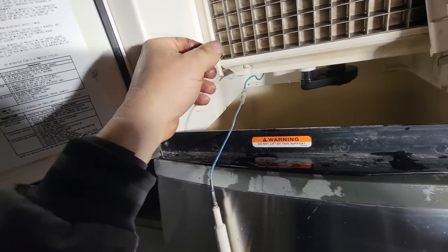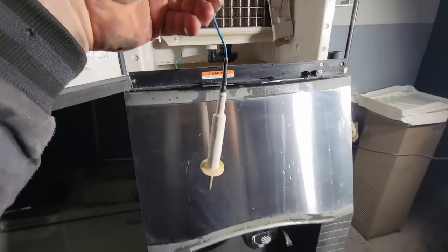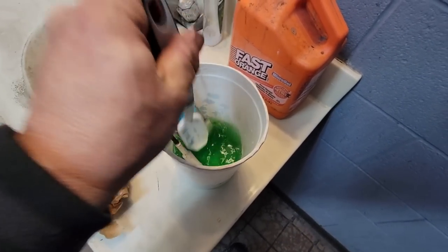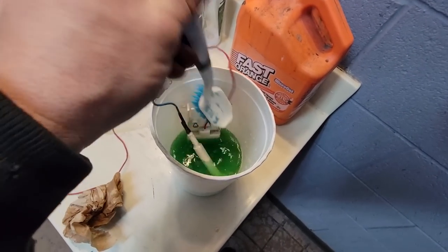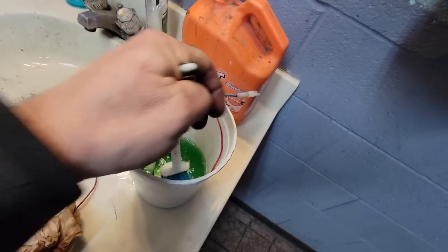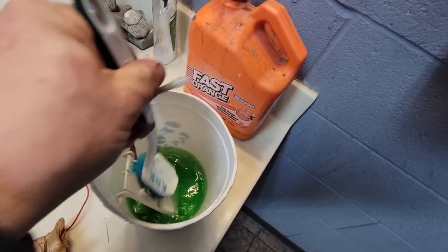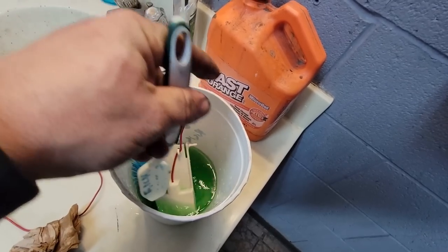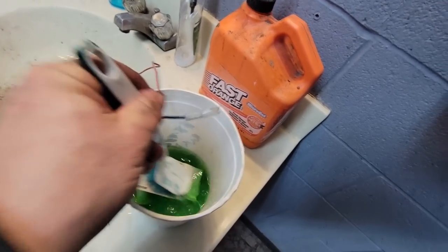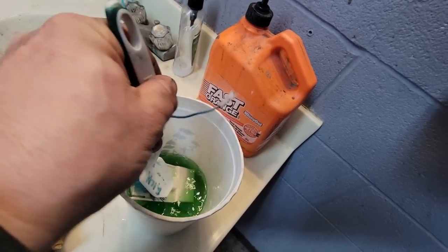That's the kind of dirt we got in the back and the side. Pull that little part apart — there we go. We're going to let that soak and let it get into the tight spots and see if we can get the buildup off of it. Like I said, I usually have to blow this thing out with nitrogen afterwards because the water usually doesn't get deep up inside there, and it'll cause it to think that it's touching the ice and false alarm out. I've tried blowing it out by hand and that doesn't work — literally I've got to blast it out with nitrogen.